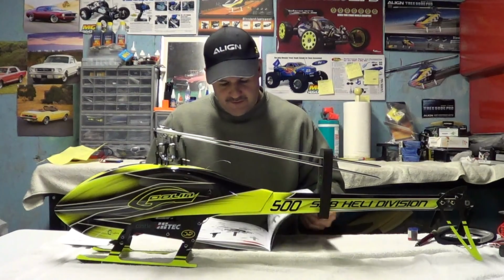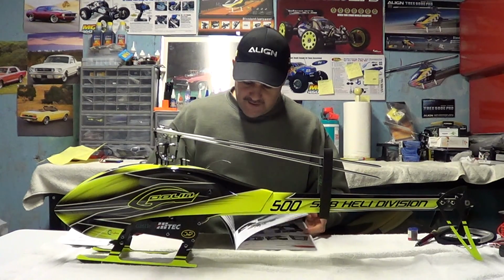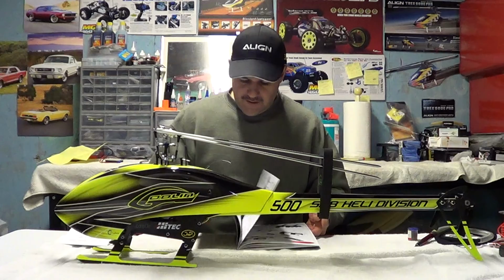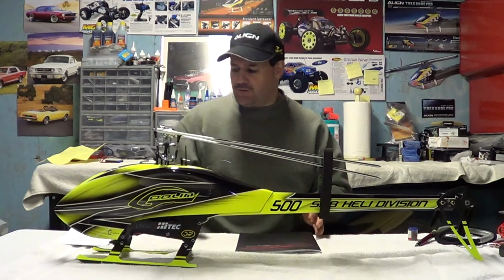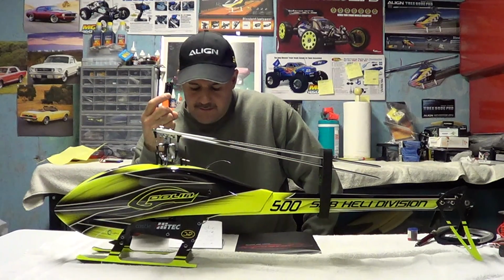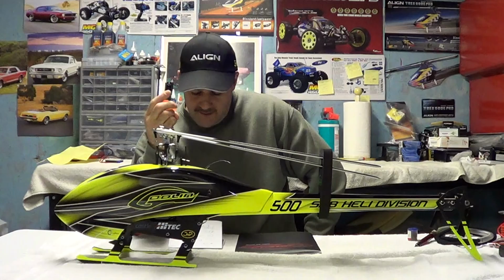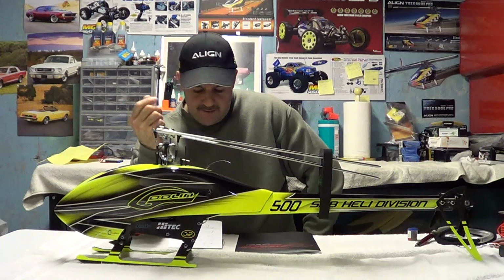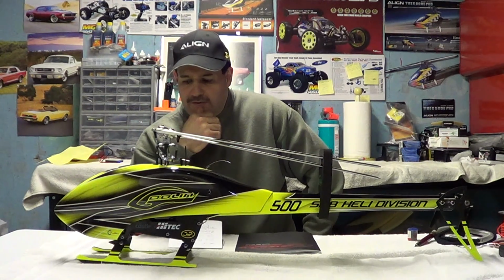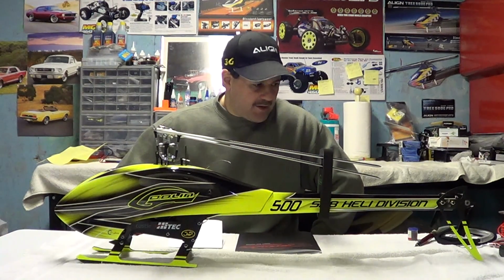Let me see if there's anything else here we can really talk about, because I don't want to drag this video out any longer than we have to. I know people don't like to watch long videos. But as for really the tips, guys, that's what it comes down to: what I told you about cutting the motor and extending the electronic speed control wire with a JR wire you can get in between, and just reading the manual good and making sure you understand everything and how everything goes together. The belt going the right way, like I said, cutting the motor down.